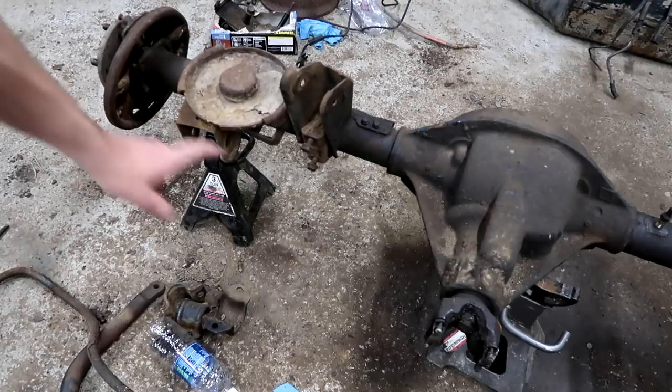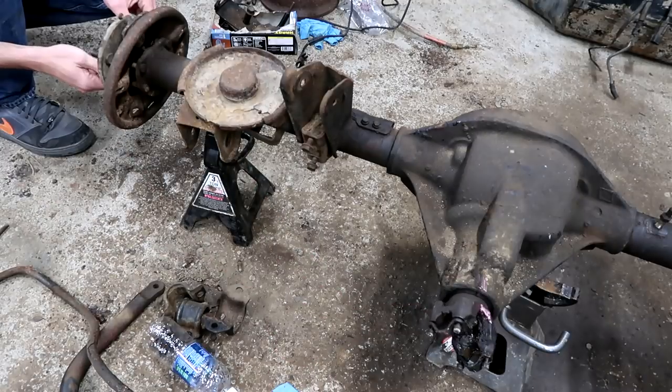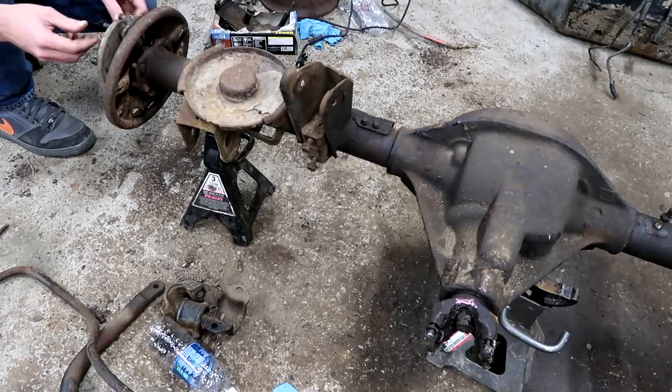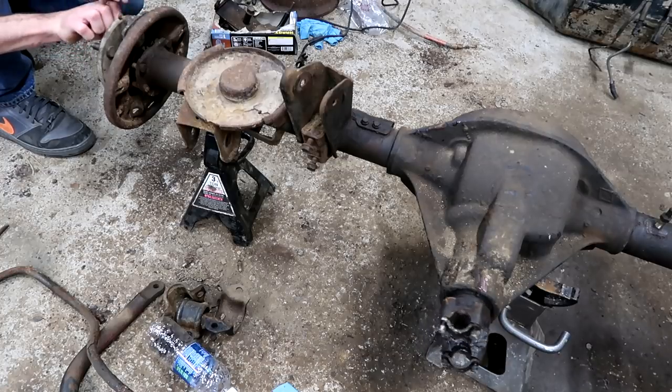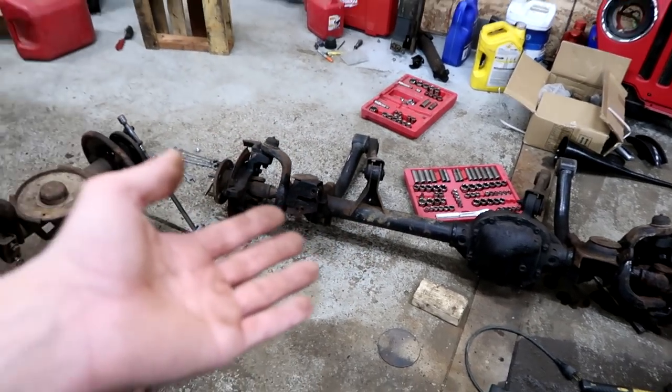With the power of technology I can see both the yoke and the hub. I'm going to turn the hub 10 times and see how many times this yoke turns. After spinning the hub 10 times, I multiplied the number the yoke spun by 2 — it was originally 20.55, multiply that by 2 it's 41.1, divide by 10 you get 4.10. So that's the gear ratio of that differential. We may as well check to see if this is a matching set — I don't want to be running 3.73 in one and 4.10 in the other. We'll throw them on the jack stands and check it.